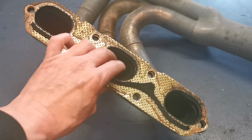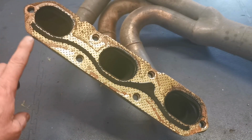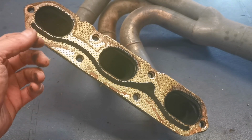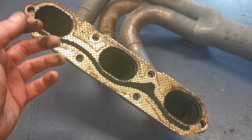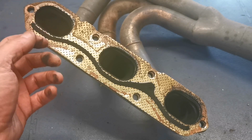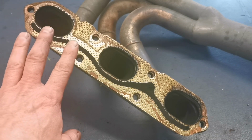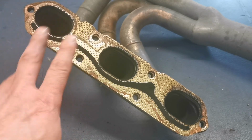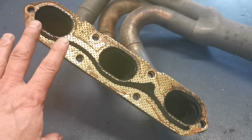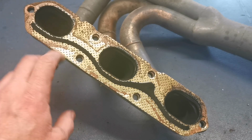Now what I also noticed was I had a bit of bother with this rear bolt. Whenever I was going to unscrew it, turn it around, it started getting tighter on the way out. So I had to heat it with my heat inductor and just tease it a wee bit. Otherwise that would have snapped on the way out, no doubt. If I had just hoofed it with an impact gun or something, it definitely would have snapped and been in the same place.